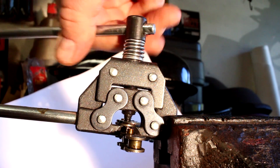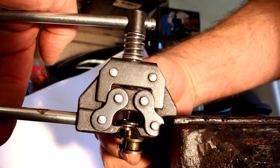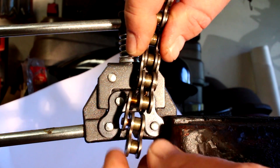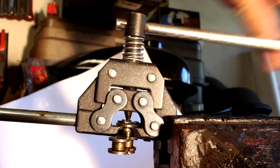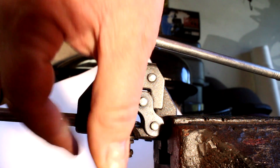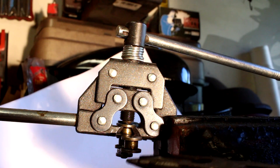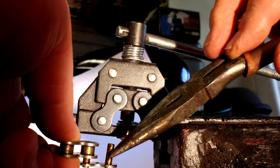Sometimes with a chain, the pin link and everything will just fall loose at this point. Quite often your newer chains are pretty stiff and it's pretty hard to get that pin out even though we've popped it loose from the plates, so sometimes you need to wrestle with it. Quite often I will use the tool to finish the job — put the chain back into the chain breaker tool and use the pin to push out the chain link. Sometimes that's not even enough, so I have to use a pair of needle nose pliers or a flat blade screwdriver to pry the pin out. Here you can see how the pin has been forced out of the roller link using the tool.